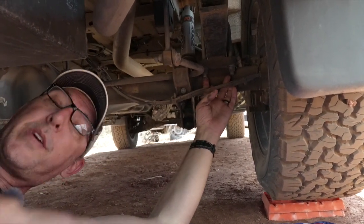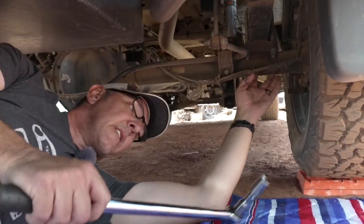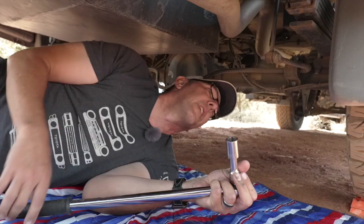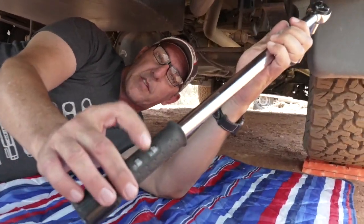If one clicks, always check the other one — sometimes you'll get a little movement side to side. We checked the Beast user manual. The Beast user manual says 130 foot-pounds of torque for these U-bolts. So we have this set at 130 foot-pounds right there.